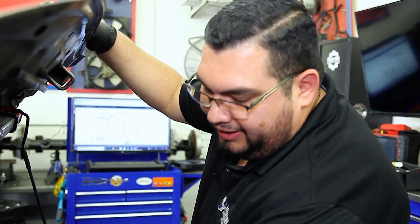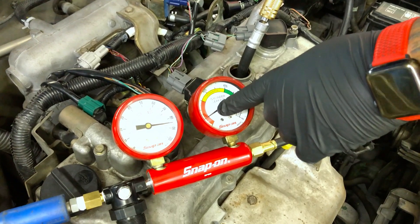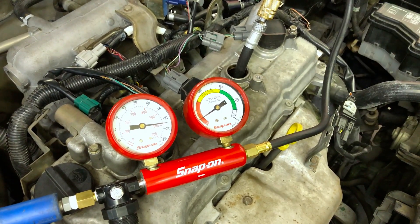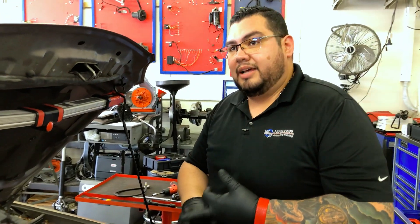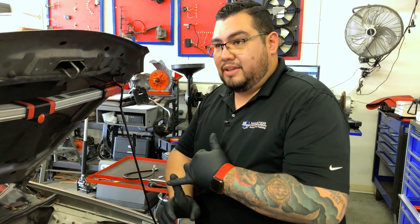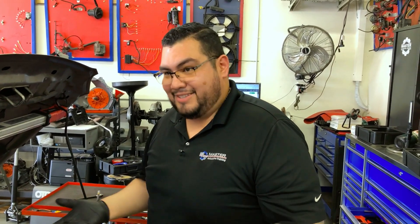You run the leak down test and then you get this kind of result. Anything that's in the red is bad. We have over 80% loss of volume on this specific cylinder. So now our job as a technician is: where the hell is it going? You have a couple of different options. Remember your cylinder has access to the PCV or the oil, has access to exhaust, has access to intake, and also has access to coolant — not that we want access to coolant, but it does have access to it.